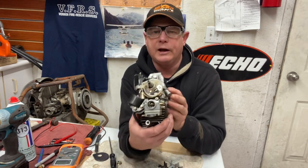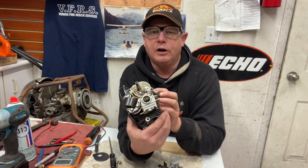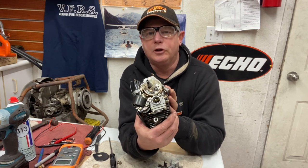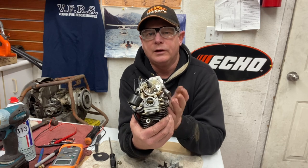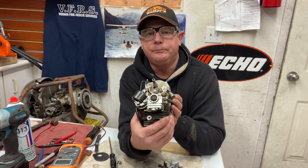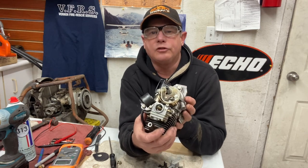This thing's like brand new. I cleaned the point contacts with some paper and some brake cleaner, and rubbed them a little bit with some emery cloth just to clean them up. They're shiny and nice. So I set them at 18 thou and let's try checking it now with the ohmmeter.